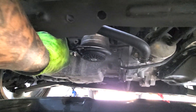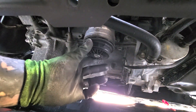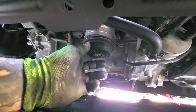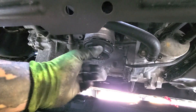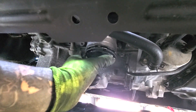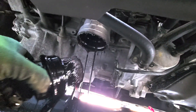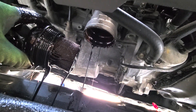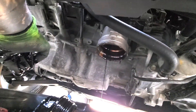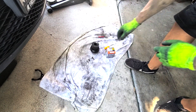I'm going to try to get this on here nice and tight and twist carefully without damaging the plastic with our wrench, and get it loose enough with our oil catch below so we can take it off with our hand. We've got it loose enough now. The reason you probably want to drain it first is so it doesn't make a mess, because the oil is going to start coming out. But let's just get her loose and let her start draining. I've got gloves on. The oil was definitely due — it was dark. We did a lot of miles on her.